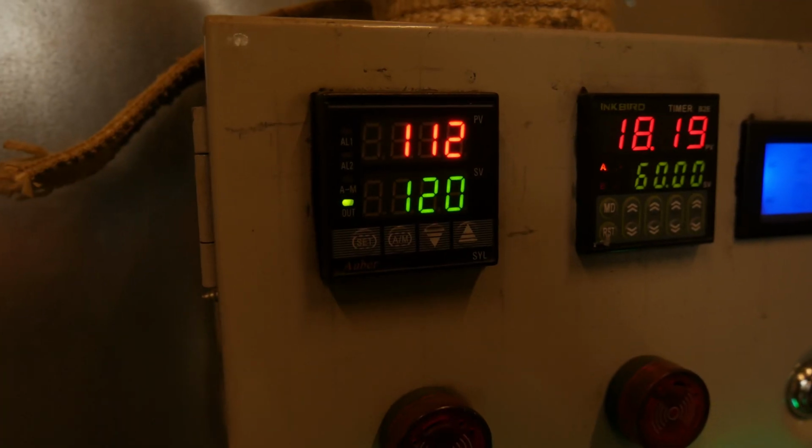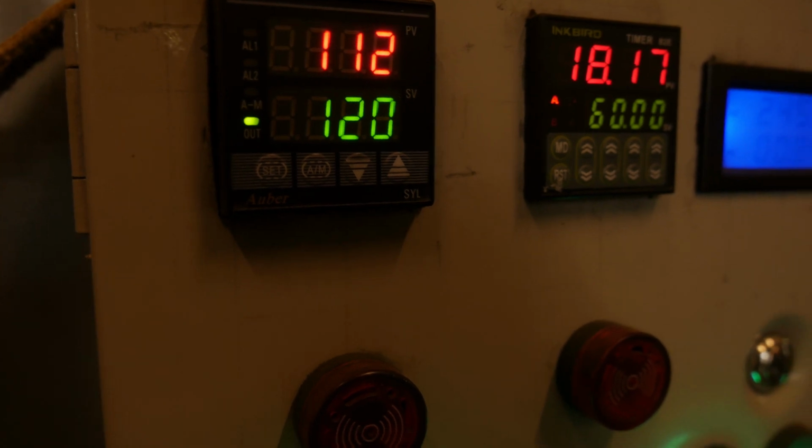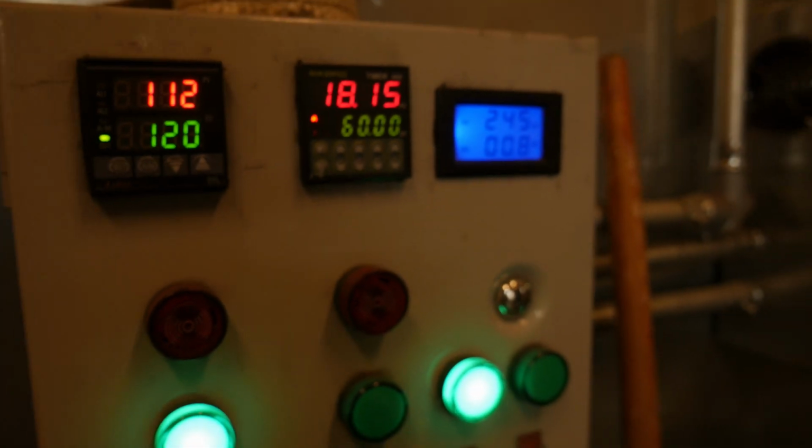Good morning, it is the next day and we are getting ready to weld in our firewall patch panel. We've got it in the oven right now at about 110 degrees just to help speed up the curing process for that primer. The fingernail test, it didn't really pass, so before I throw a bunch more heat in it welding, and then blister all the edges, which may happen anyway, I'm going to try to go ahead and avoid that if possible. So once that's out of the oven, we're going to let it cool down to room temperature, and then we're going to go ahead and get it all welded in.